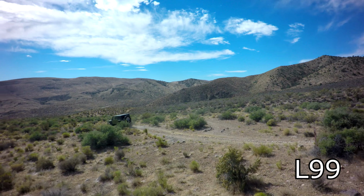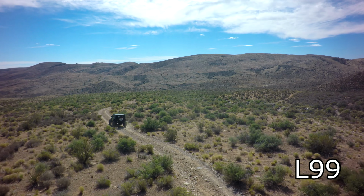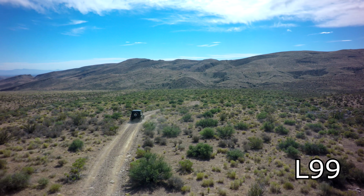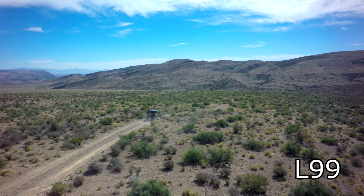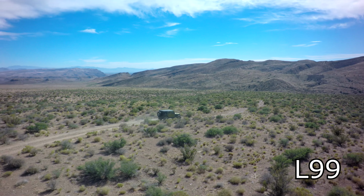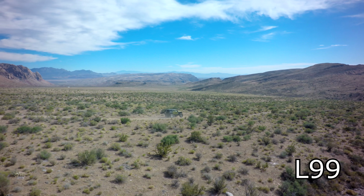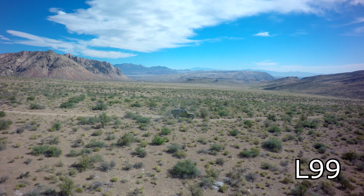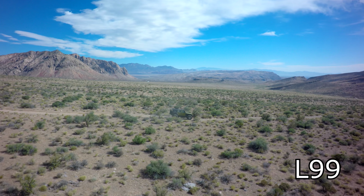But the reality is, the 6.2 is more like the SS Camaro muscle car engine. It's got over 400 horsepower, all aluminum, high compression. You want to go out and show off to your friends, that's the motor you want to get. Or if you have a really heavy JK that you're going to take up to altitude, that extra displacement and compression is going to help. You want the 6.2. If you're an expedition guy and you just crawl around like a turtle, and you have a really heavy JK, the 6.0 is going to get the job done. But it's not going to have the top end performance of the 6.2. It's not going to pull your heavy JK in the mountains quite as well as the 6.2.